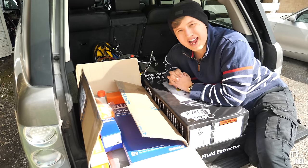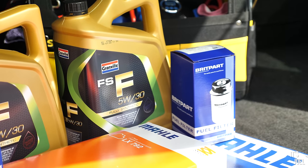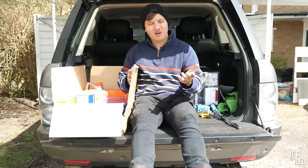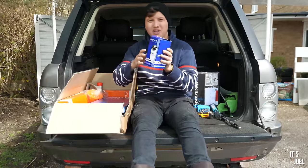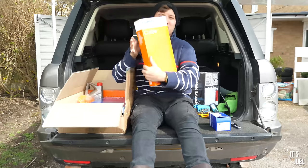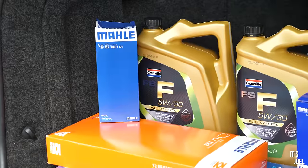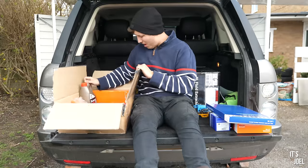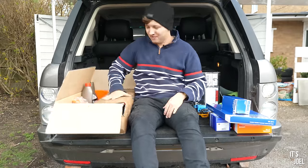Let's go through what we have. Here is everything we need for the oil service today. Parts will be linked in the description — basically the same as on Sam's video. This is the service kit from Advanced Factors. This is specifically for the 3.6 TD V8, which only has one air filter, although I've bought a second as a spare. We've got the fuel filter, the diesel filter, the air filter, the cabin filter, two lots of five litres of oil, some coolant for topping up, and the oil filter which is the first thing we're going to start with.